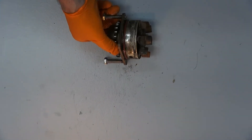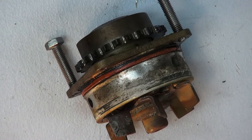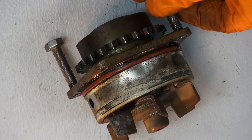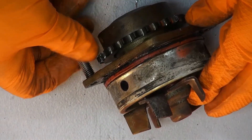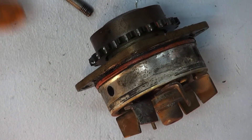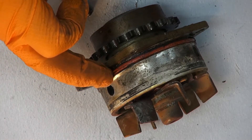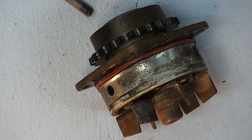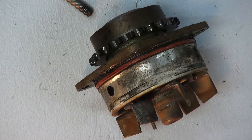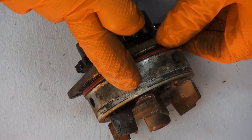I want to take a look at this water pump that I removed from the Nissan — it was definitely leaking. You can see the screws I used to jack the water pump out of the block. The reason you need to do that is these two O-rings: the red one here seals the crankcase oil, and the black one behind it seals the antifreeze or coolant. You can see places where the seal's been breached and there's been flow.